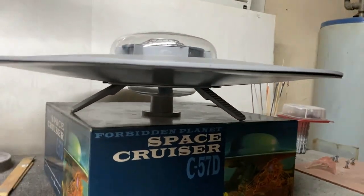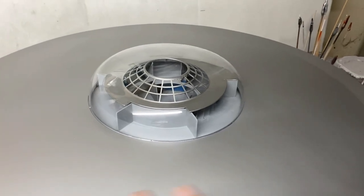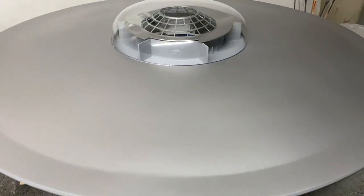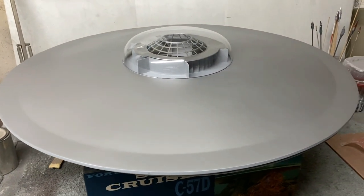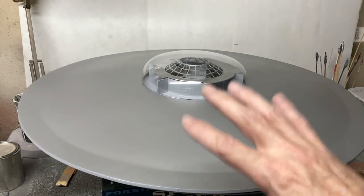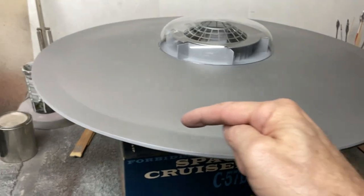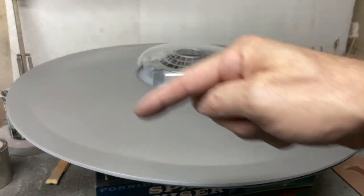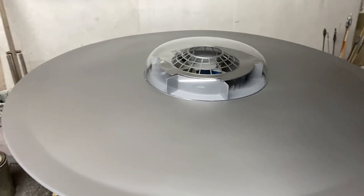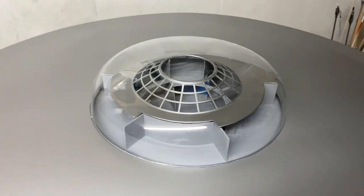The top part of the core is looking good — that's what we'll be working on in the next video. Over the next few days I'm going to do my cleanup and repaint it to get it all nice and even, then it's got to have a clear coat put on it. I'll be painting the outer ring the darker color it's supposed to be once everything's been done on the interior and we can glue it all together. We'll do our final puttying on the seam on the outer edge, then mask the whole thing off using vinyl tape to make the curve, and paint that darker ring color. I'm thinking kind of a gunmetal color for the top of the bottom — a little bit darker than the hull color itself.